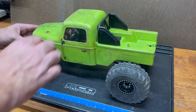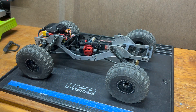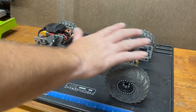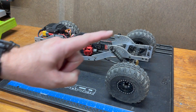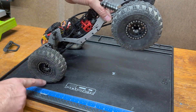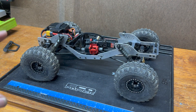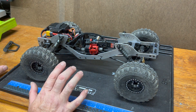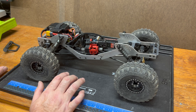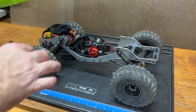I'd also like to point out in the spirit of full transparency: this is not going to be 100% accurate - it simply cannot be. You have multiple components of your suspension working all the time - this is the sprung suspension component and this is the unsprung suspension component; this is a spring. When we raise one end of the vehicle, weight is going to effectively transfer dynamically. What we are looking at to truly find the CGH is the static weight transfer, but to do that would be an episode in real minutiae.